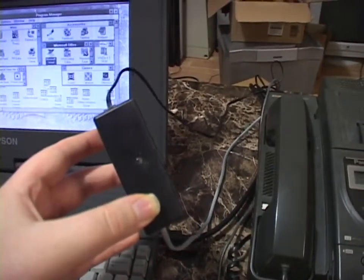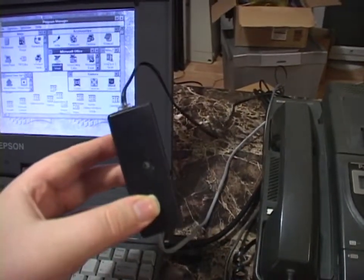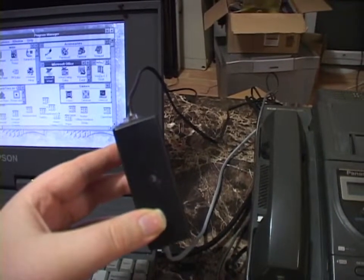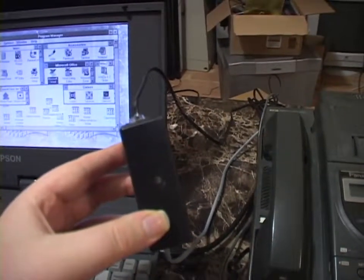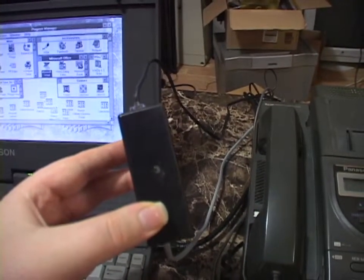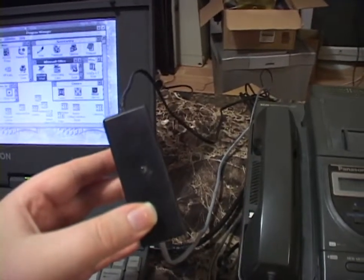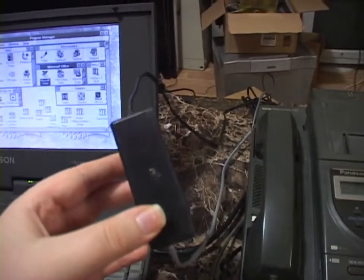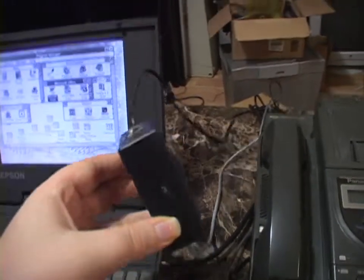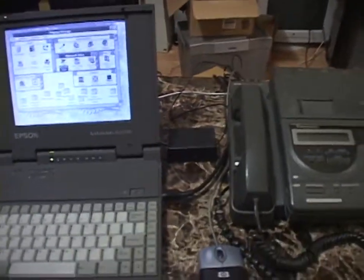And when you plug something into these RJ11 sockets, such as two computers via their modems, and you run the right commands on those computers, and you enable the right settings, such as disabling dial tone detection and stuff like that, those two computers can handshake via their modems and have a connection between them as if they had actually made a telephone call between each other. And you can use that connection to transfer data or stuff like that.